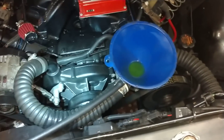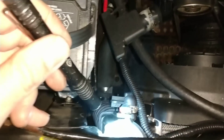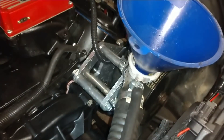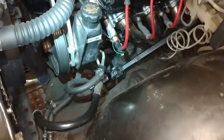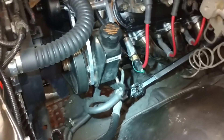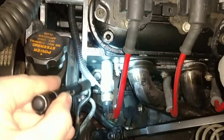The upper hose is two universal hoses — not exactly the cleanest. I could have gone with an F-body water pump but then I'd need an F-body balancer and accessory brackets to route the hose better, so what I'm doing is fine. There's the original fill cap which I don't use, and an aftermarket Moroso cap — I use a 10-pound cap because I don't like a lot of pressure in my cooling system. Stock truck water pump, stock truck power steering pump — it's a Saginaw pump — and the fittings and hose are the same as the S10 with a metric fitting on both ends.